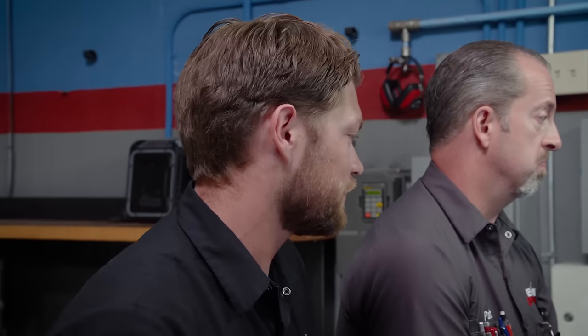That flat torque curve is exactly what you want — it just carries. The air-fuel ratios and oil pressure both look great. At 629 horsepower and 577 pound-feet, this hits right in the middle of where we wanted it — close to the torque of the second version and about 20–25 horsepower up on the first version. The key changes: new cylinder head, new camshaft, new intake manifold, and a different carburetor. Despite all that, this is still an engine you can put in a car, drive to the strip with the AC on, and then make a pass.